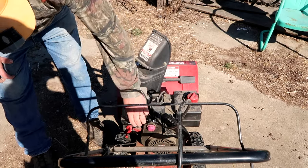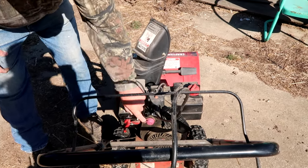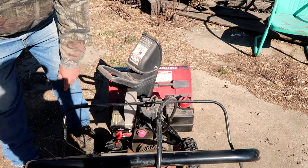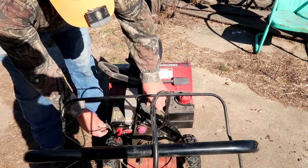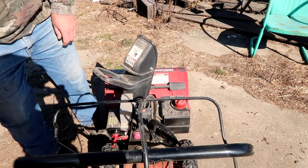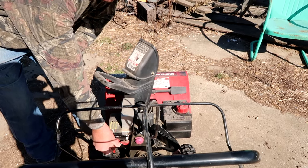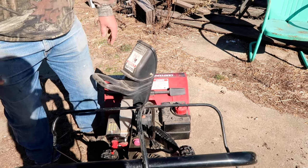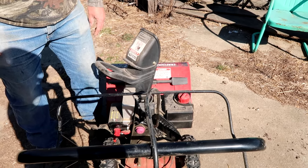It does start, and we're going to put it on choke, get it primed up. It's got an electric start. The issue with it is, when I try to take it off the choke, it dies. Let me get this started. Let's run it, and I'm going to take it off choke. I couldn't even get it off all the way, and it died. So, problems in the carburetor, let's go take a look at it.